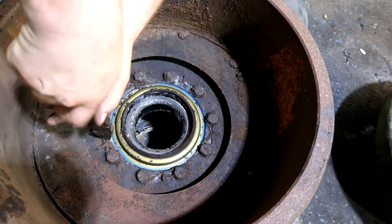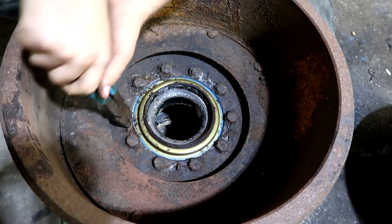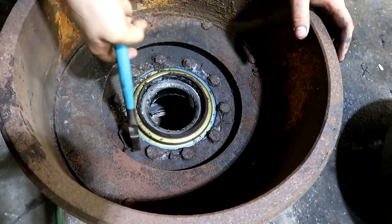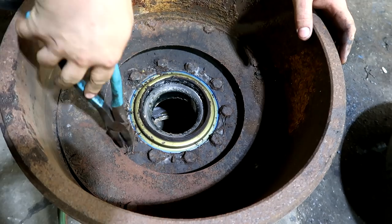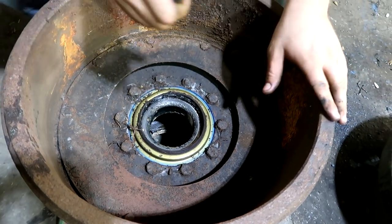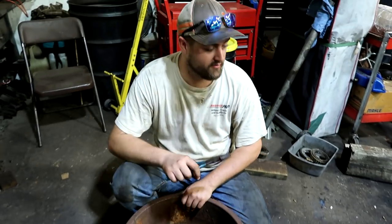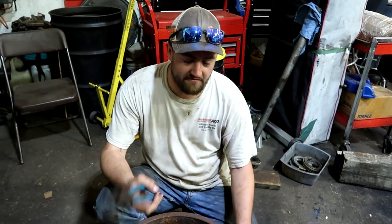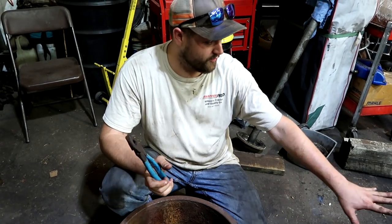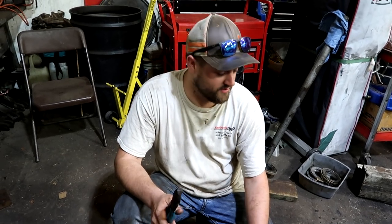Alright guys, I am currently cutting these safety wires off the bolts that hold the drums to the hubs, and we are going to remove the drums from the hubs. We are not going to be running drum brakes on the front and rear axle. The front axle has already been done. We are going to try to get this rear one rebuilt — if not by the weekend, then by Monday or Tuesday next week. And then get the front axle in here and get it completely de-braked.